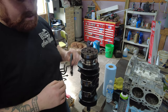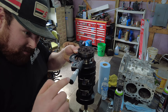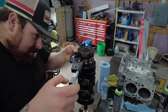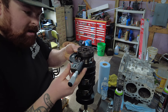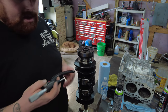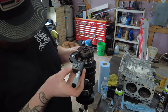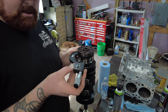What just occurred to me is you guys probably don't know how to use one of these micrometers. You're holding the journal here and keeping your finger on the end of the thimble, then rocking it back and forth and watching the end. You'll go from seeing it perfectly flat to having a gap — keep rocking to find that nice happy median. Lock it in place and we pull it out. I'm getting 2.3620, which is exactly what I had before. That is how you do it — just slipping this thing around the journal.